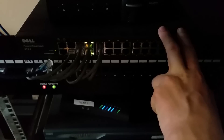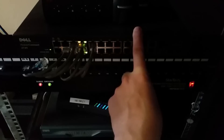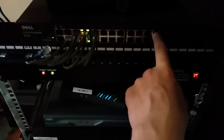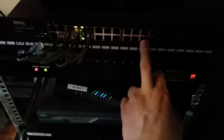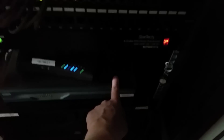What we're going to do today is switch this from unmanaged mode to managed mode. It's a Dell PowerConnect 2724 gigabit switch. I'm going to set up some VLANs — the odd row is going to be VLAN 1 for my Bell router, which handles internet for my apartment. Then I'm going to set a second VLAN for another router so I can experiment with settings without screwing up the internet for everyone else.